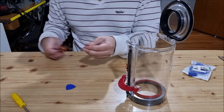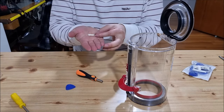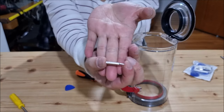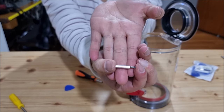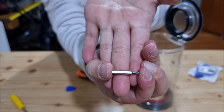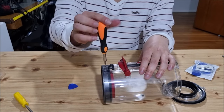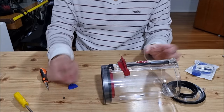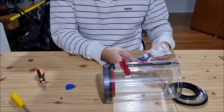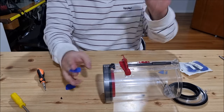Next we're going to remove the bottle ring. There's a Torx T8 screwdriver screw that you need to remove. Here's my Torx screwdriver — it says T8. After removing the screw, you need to pull the back. You won't be able to pull it if yours is new — you're going to need prying tools to leverage it out. You need flat prying tools like this.